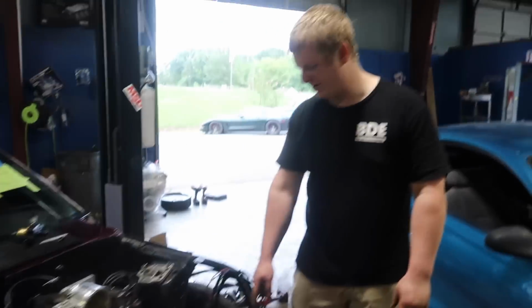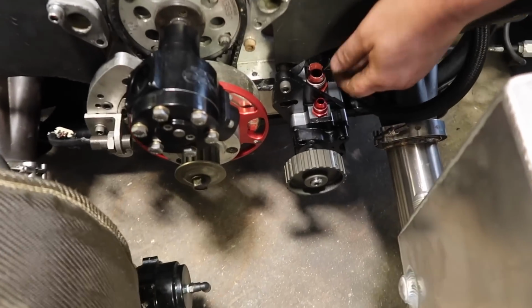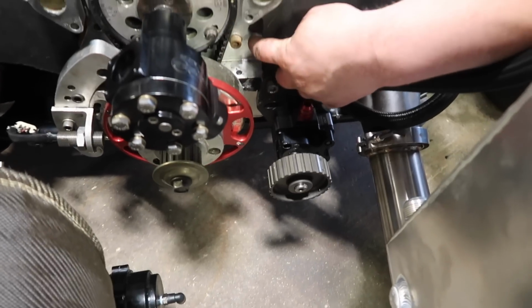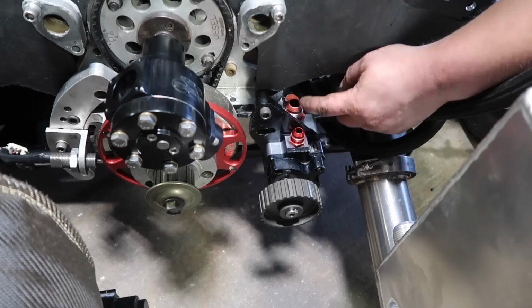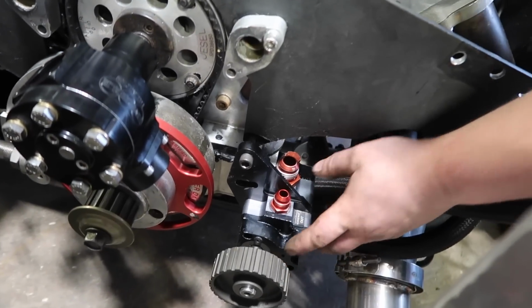I'm torn too. If anybody knows the part number, this is the oil pump. It can either get mounted to the motor plate or to these bolts that hold the front plate to the Jesel drive. I'm also torn on the oil filter: this comes from the pan into the bottom of here, and we're going to have to get a remote filter. Do we get one of the Peterson ones that has the little ball end on it for the prime? Or just the standard, like a System One, or a Clear View?